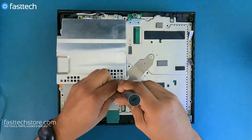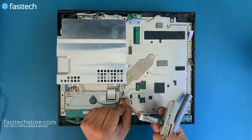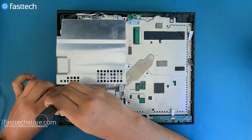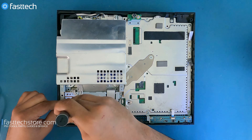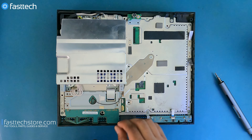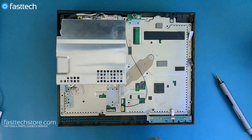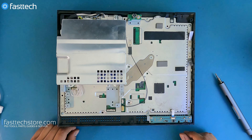I'm going to remove the screws that hold the memory card holder, then lift this cable up and out. This is the network module that controls your Wi-Fi and Bluetooth — there are four screws that hold it in. Now we're going to lift up this cable, lift up the board, and there's a cable that runs underneath. There's a piece of electrical tape in here because at some point I had an LED light set up inside.